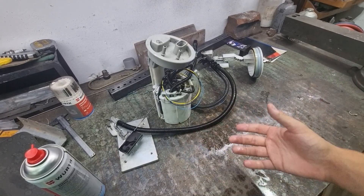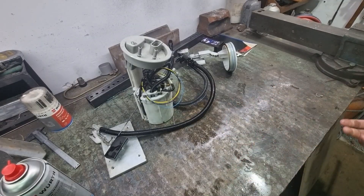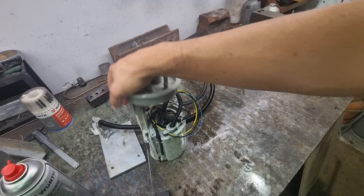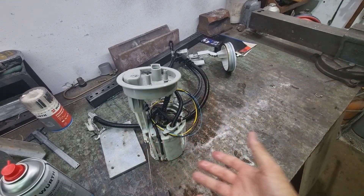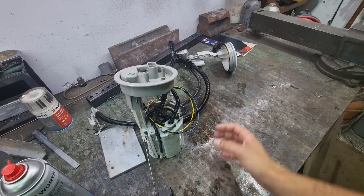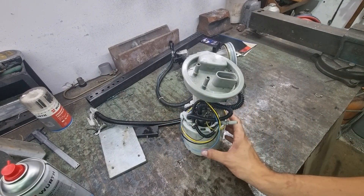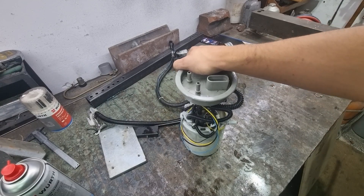If you park the car on a left hill, you'll get a wrong fuel indication. What Volkswagen managed to do here — and I need to say I'm not a Volkswagen fan at all, it's really bad design with a lot of flaws — but what they managed to do is make one fuel pump work for both portions of the tank and you never get air in the lines. It's a brilliant method for fuel transfer from both portions with only one pump. That's why you have the ejector and the pump divided into two sections. In a moment I'll show a demonstration of how this works.